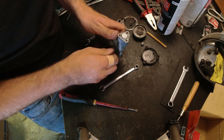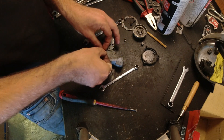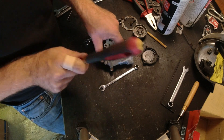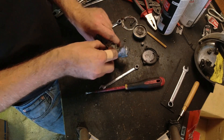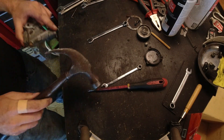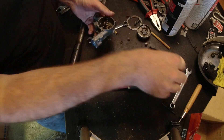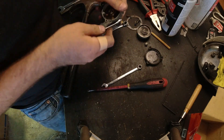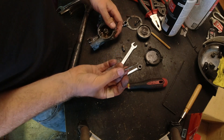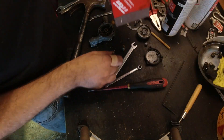You can take this off here in the back and sort of knock the whole thing out. I'm just going to tap it gently with a screwdriver. Alright, I think we're going to have to be a little more violent with a hammer. There we go. You don't really have to take it out all the way because you have a little plug here that you can open up, and there's that needle — and there is that little o-ring.